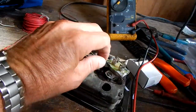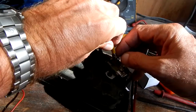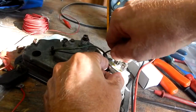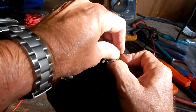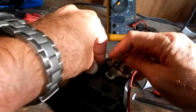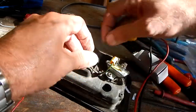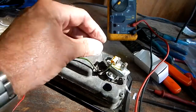Let me remove the wire from the terminal — that's the input for your fuel quantity — go ahead and hook it up, and then I'm going to bend that terminal down and hook that wire back up to the fuel quantity gauge. That ought to do it, though it'll just make it harder when you go to take it apart. Find the lock washer and put the terminal nut back on it.